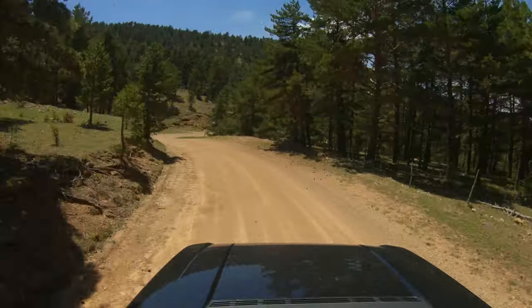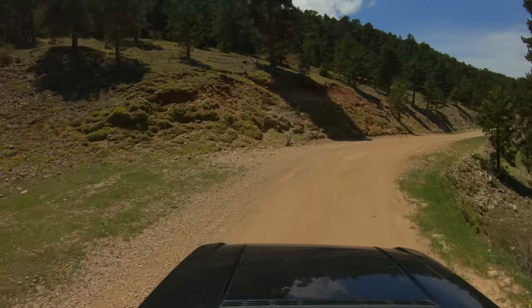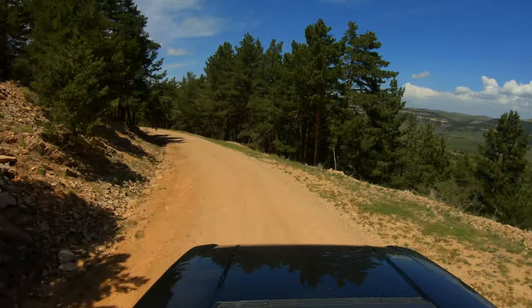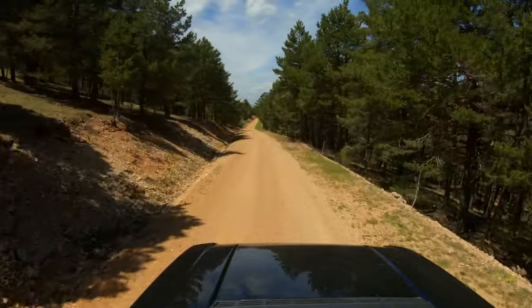I'm not sure of the exact torque figures, but low down it has got some serious grunt now that it's been remapped. Things I've done to make it more responsive: I have K&N filters, the remap of course helps, and I've removed the rear exhaust box — number one to save weight and number two to get exhaust gases out of the engine quicker. That big exhaust box has been replaced by twin exhaust pipes with really small silencers, giving a really nice V8 burble. I'll put a link in the description to what it sounds like.